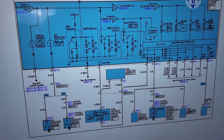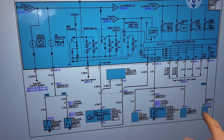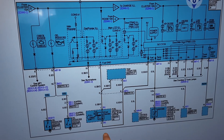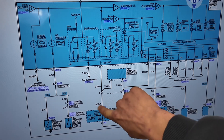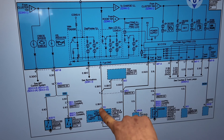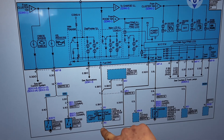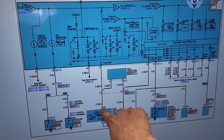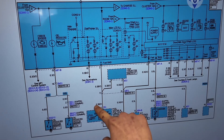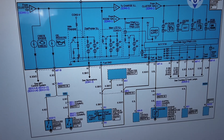Back at the diagram, just running through what we've got. We've got our voltage coming down on our signal line. We've got voltage here, which we shouldn't have - we should have ground here. So we think it's picking up a voltage path through the sender. What I'm going to do is go back to it, unplug it, make sure this wire is dead.